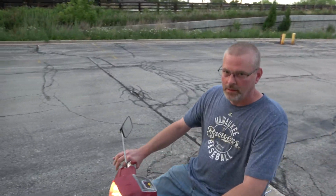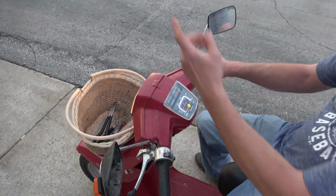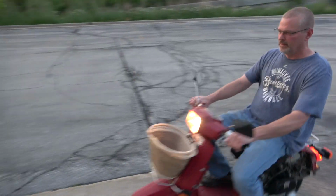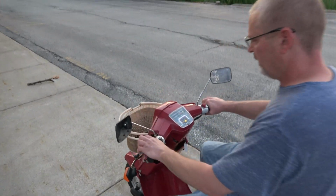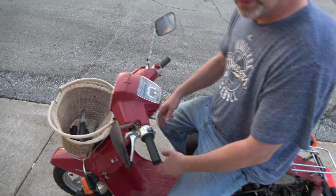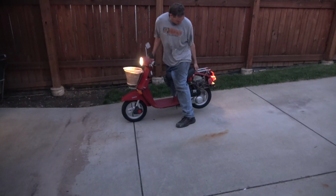All right, boys, I got her leaned out. Oh, he's pulling her in the pits. What's the situation? I would say it's slower. All right. I could only get 25 at the same distance. Let's fatten her up, eh? 30 the last time. What's the prognosis? I'd say about 28. So idle's like shit now too, you know? Yeah, put it back in the middle. Probably.